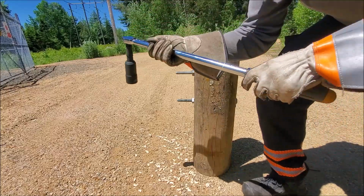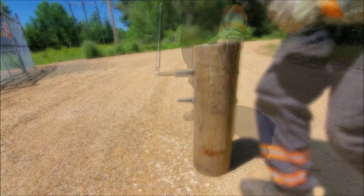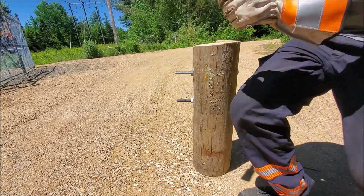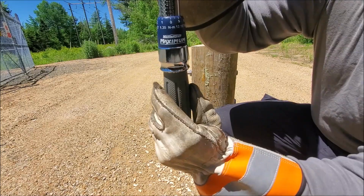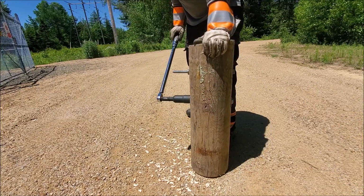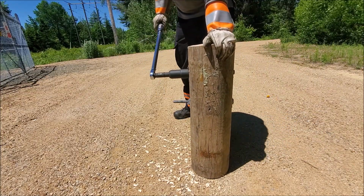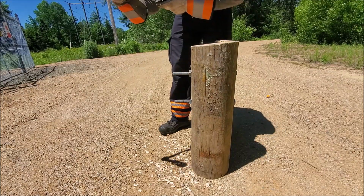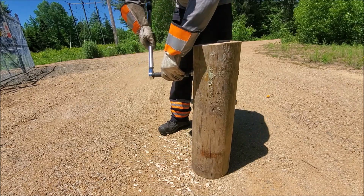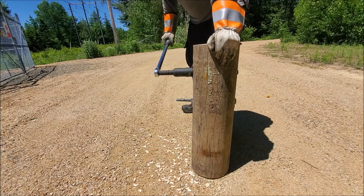All right, so we've got our torque wrench here. Let's start off with a modest 80 pounds of torque. Let's see what happens. All right, so there's more than 80 pounds on there. 90 pounds of torque. So we're all the way up to 140 foot-pounds of torque now. That does her there. All right, try that top bolt. And we still got a click. So somewhere between 130 to 140 foot-pounds of torque on the nut and bolt itself. We're at 140 now, and oh, it's pretty close right there.